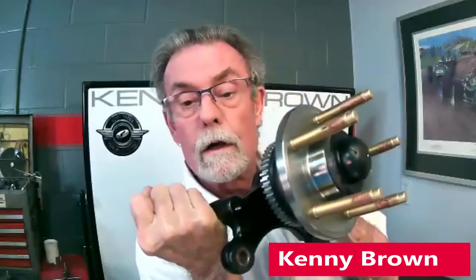You can see the little dabs of anti-seize on there, and that's specifically because if you're taking the wheels on and off repeatedly, threading the lug nuts on and off, you've got metal on metal. After a while they're going to start chewing on each other and one of them is going to fail. So by putting a little anti-seize on there — or even a couple of drops of thick oil — you're lubricating the threads.